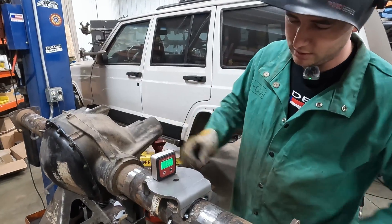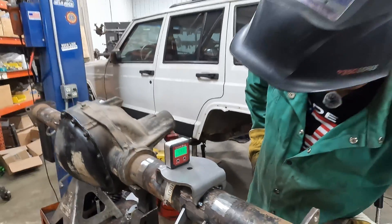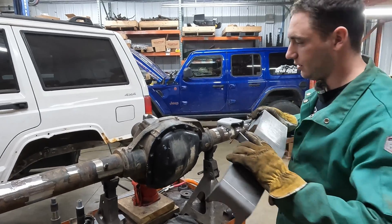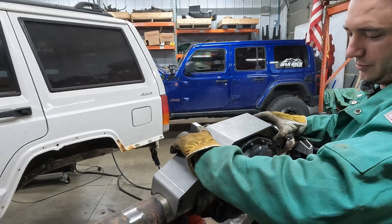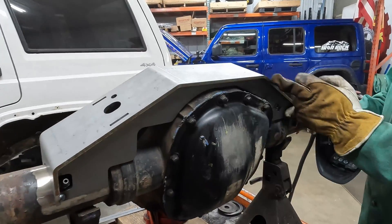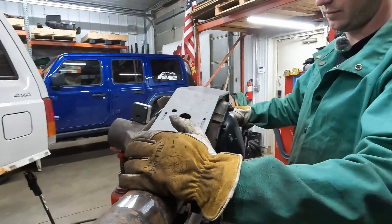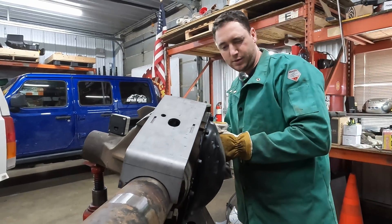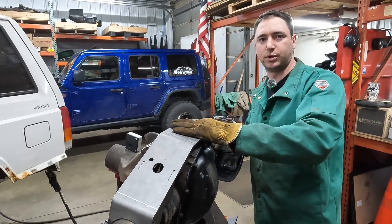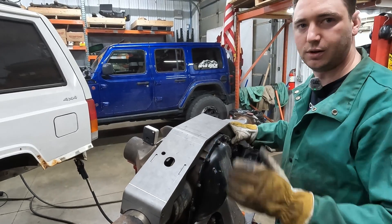Got her tacked on — that's pretty dang close. We're ready to get our truss on our axle, so we're going to slip it over our breather there. You want to make sure that this plate is parallel with the mounting surface of your diff cover — you've got a little bit of play back and forth. Get it as close as you can, because that's going to adjust essentially your upper control arms if you're pitched up or down. So we'll get that nice and flush and get her tacked on.